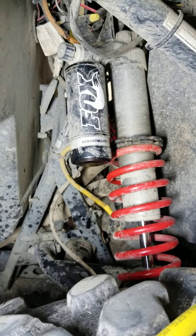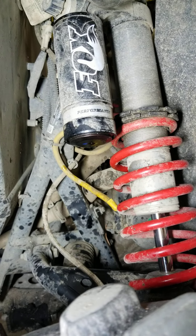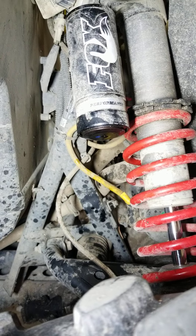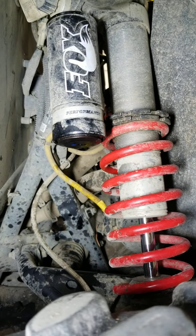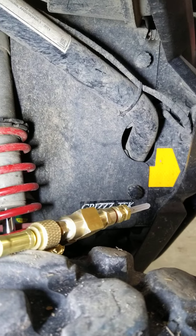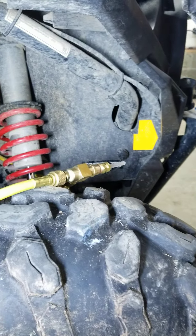The shock is recharged now. There was, like I said, a tiny bit of oil leaking from the bottom — that's just the rubber self-healing seal for the needle. I'm curious to see how long it will hold its charge. If it continues to lose pressure, the alternative is to take the bottom caps off, re-drill them, and install Schrader valves — there are other YouTube videos showing that approach. But the needle works quite well, and it'll be interesting to see how long the charge holds. Anyway, that's a poor man's system, but if you're already welding and have argon, for under $150 you can have your own setup to fill your shocks.